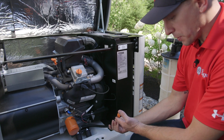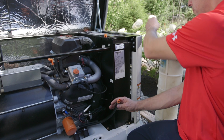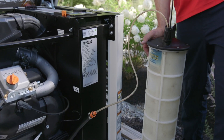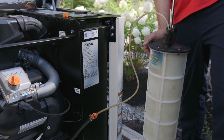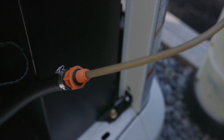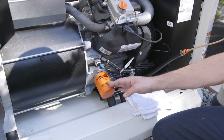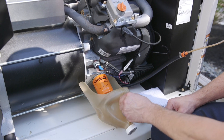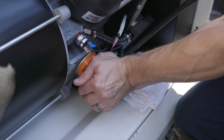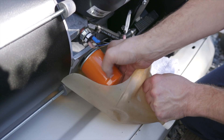This is our oil drain. If you're going to drain into a pan, you would bring this down and drain the oil that way. But today we're going to use an oil extractor. Next we're going to remove the old oil filter. You can use a scoop or some means to catch the oil coming out and then a rag to clean up if you do spill any. This is going to be warm when you take it off, so be careful. We're going to remove the oil filter, get our scoop in place and let that drain out.